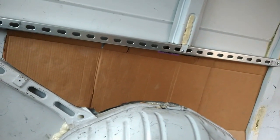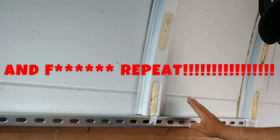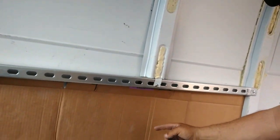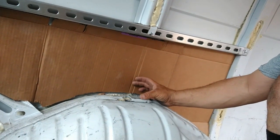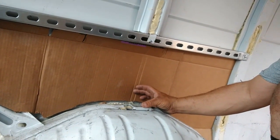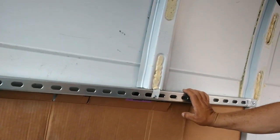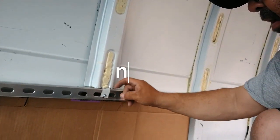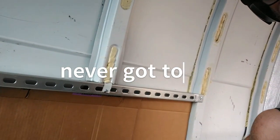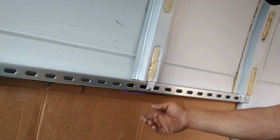For the wheel well, I did the exact same thing — I took a piece of cardboard and kept cutting and shaving until it fit just perfectly. Right here, the reason I cut this beam was because it sticks out about 5 inches. This is where the bed's gonna be and I don't want it in the way, so I brought this up and put it in for reinforcement. Right now it's being held with screws, but I'm planning on tack welding along these edges to make sure it's nice and sturdy and reinforces the piece that I cut.